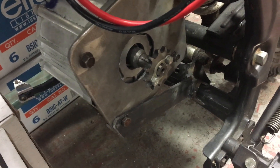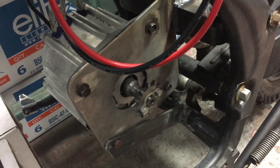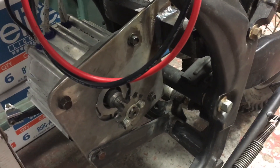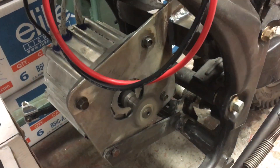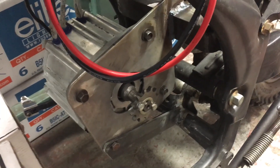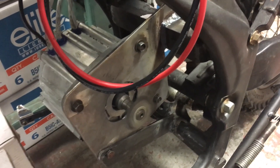Pretty smooth — the loudest part's my sprocket moving around on the shaft. It's got a lot of steps in the throttle and there's no kickback like I was having with the other motor. The LR HDD and the KLS have some sort of a problem; they're putting out a weak hall signal and it just makes it really dangerous to control. But you can hit the gas at any RPM whether it's increasing or decreasing in speed and torque, and it doesn't mess anything up.